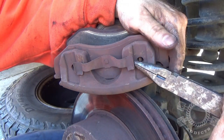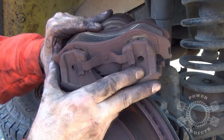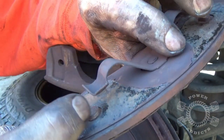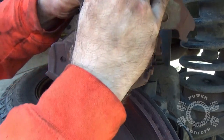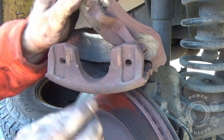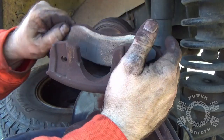There's a little trick for the brake pads — a lot of people want to pull the spring back and pull, pull, pull thinking they can get somewhere, and they're not. Take your pad, push it that way, push the pad the other way, then pull upward a little bit — see, it unlocks. That's because you've got holes right here and little posts right here that engage inside those holes. The posts are designed so the pads don't wiggle. Push your pad sideways and then up — slide them right out.